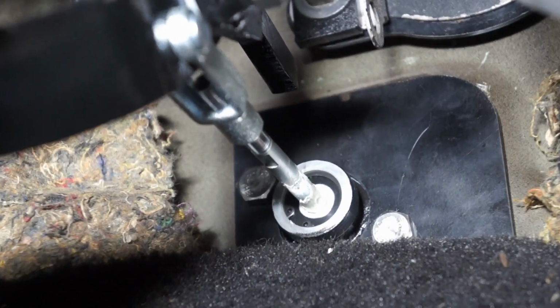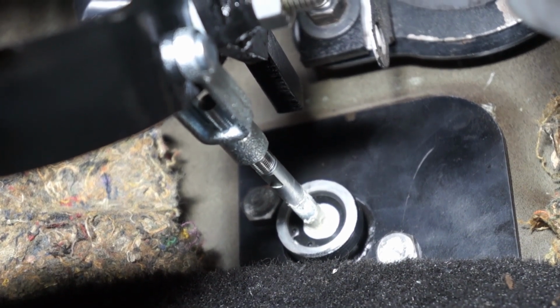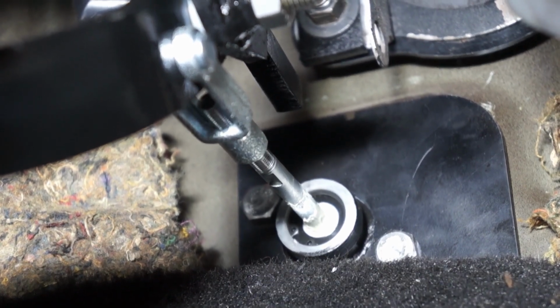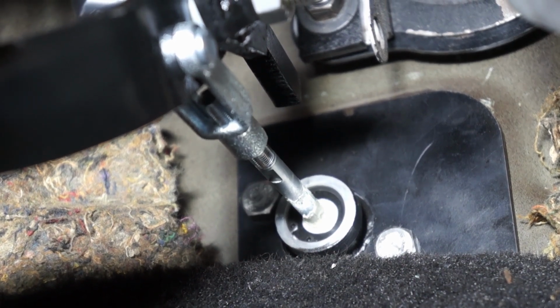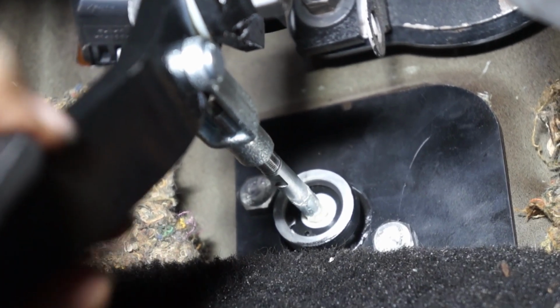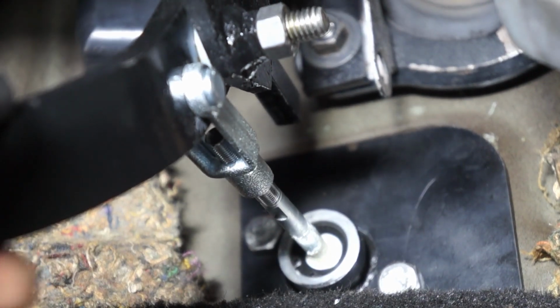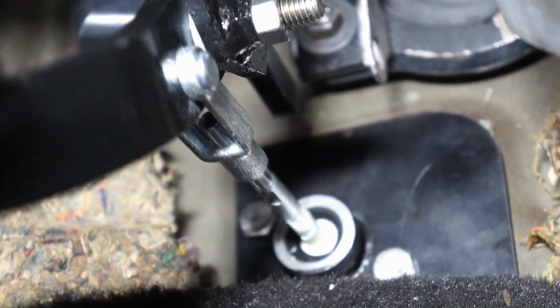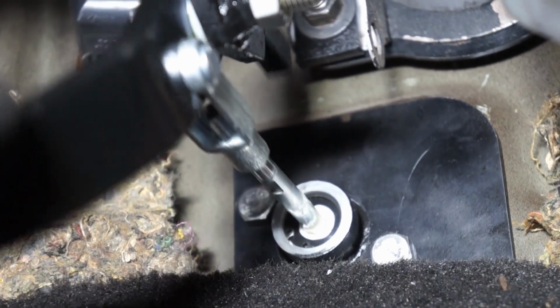As far as the adjustment of the position of the master cylinder, you've got to be pretty straight. If you follow the instructions carefully, it fits as is. There shouldn't be any corrections to do. One thing you've got to keep in mind is that when the push rod is entering the master cylinder, it goes through some sort of a washer there. So if you're off axis, it will rub either up and down or left and right. Like in this case, it's not rubbing on anything, it's free to move. That's what you're looking for.